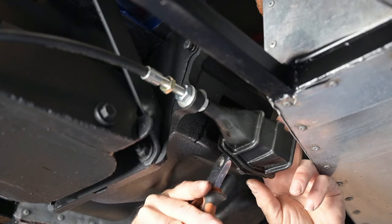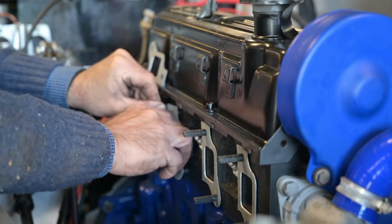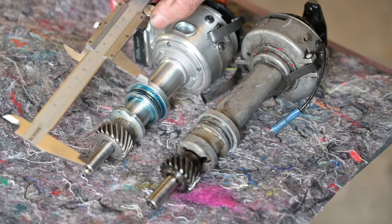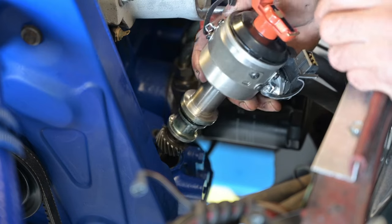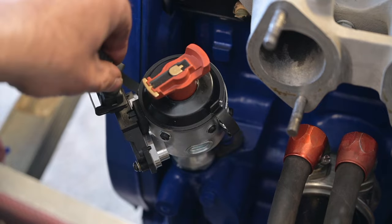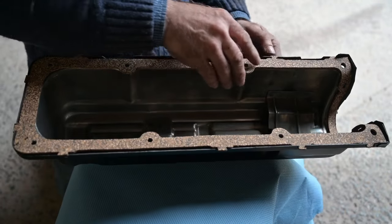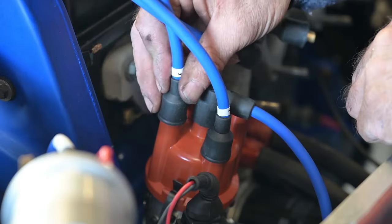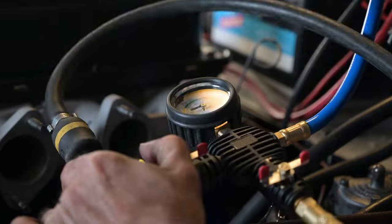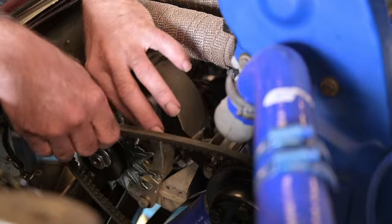Now it was time to fix the clutch cable, which was in a very awkward position, so I reinstalled that. Then putting back the exhaust with new seals on the exhaust manifold and also installing an electronic distributor. I don't like the old breaker points, so I changed to an electronic 1-2-3 ignition module which is programmable. Here I'm double checking the pressure on the fuel line so as not to over-pressurize the carburetors.